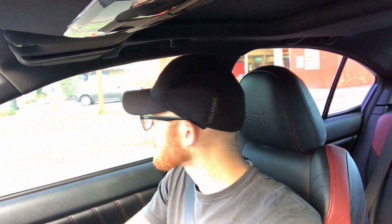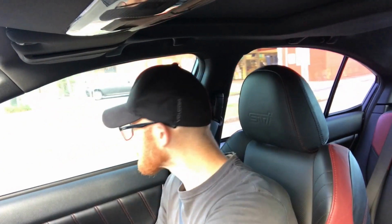Now, by nature, because it's being driven by the exhaust, it is extremely hot. And when I say extremely hot, I mean really hot. You can be talking up to 300°C sometimes. It's very common for exhausts to be operating around 220, 250, 270 centigrade, depending on your setup. So that turbo is astronomically hot, which means, again, this is contributing to a problem that you have in summer in Australia with a turbocharged car, in the fact that your charge temps are already going to be high because of the ambient temperature.